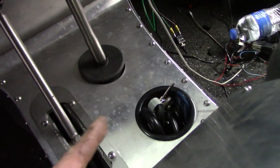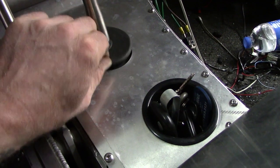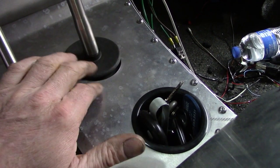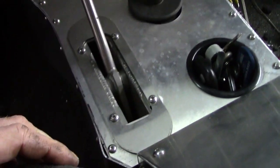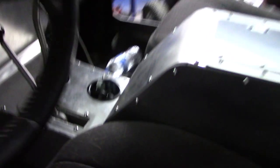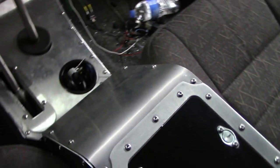On this console up here I just did one cup holder since there's not a whole lot of room. I've got my B&M shifter — I just drilled a hole with a hole saw. This boot actually comes with the shifter for the shifter itself and the transmission, but since this is so low I just cut that hole and brought it up through there. Since it's a short shifter, it doesn't really move that much. And then I've got my cable shifter for the transfer case. Thanks for watching — if you have questions or comments, let me know.